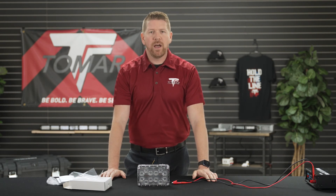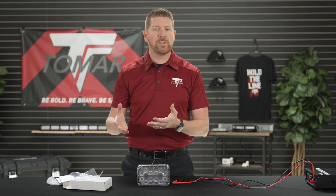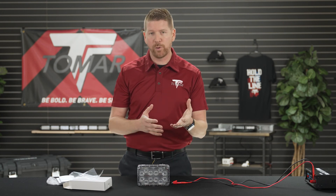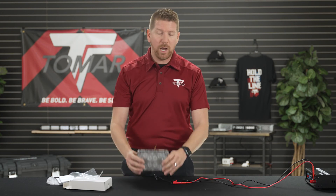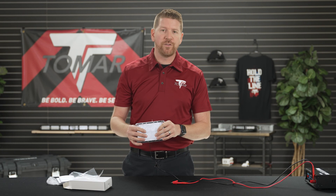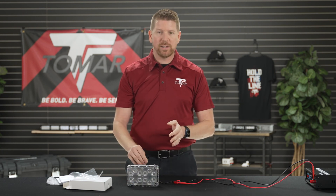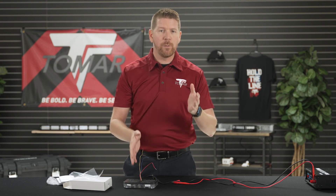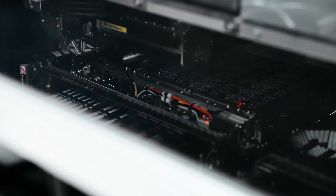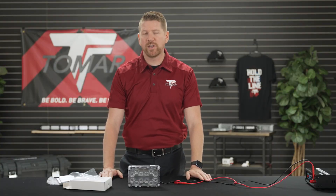That's basic setup and programming of a Revolution lamp. The idea for the pre-programmed series is to have these lamps already set up to your specifications right out of the box so you don't have to go through the process of programming. This O2 variant is set up to phase one, where an O1 variant will be set up to phase zero. When the two are combined they will wigwag back and forth, and when synced together using the yellow wire they will stay in harmonious sync throughout their entire operation. Like all of our solutions, the Tomar Revolution series is engineered in our manufacturing facility in Gilbert, Arizona, and we stand behind our products just like we stand behind you.